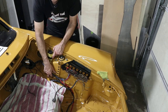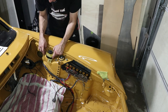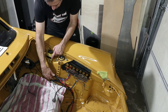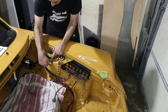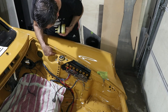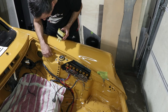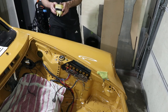There are these two holes right here that go directly into the footwell, which is perfect — that's where my master cylinders are. I'm going to make some hard lines coming up through the car with some grommets, and then just like the factory, use some rubber lines right here. I also realized I'm missing one of the clip nuts that allow me to screw a screw in there — I need to find one of those and we can get this part at least mounted.